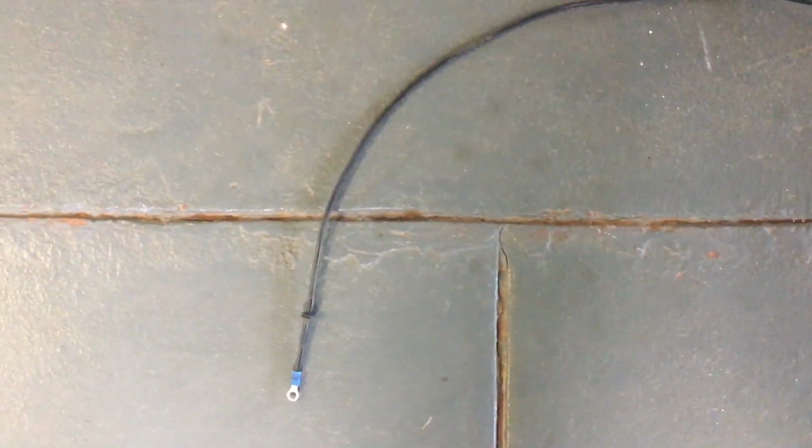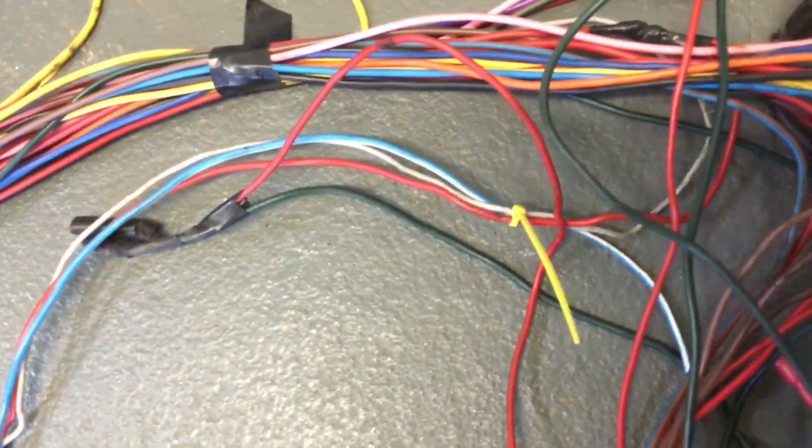So to give you an idea of how bad some of this wiring is, just one wire. That's my fuel tank sender wire to the fuel gauge. It's black. It goes to white. It goes to the plug. It stays white all the way to the front of the car. So at this stage the wire's still white. That one there. From there it goes to yellow, I think. Hang on, let me have another look. Well, as you can see, there's no white one sticking out of there. It went to yellow. So what's that one? The middle of the bottom.